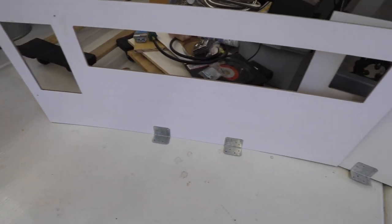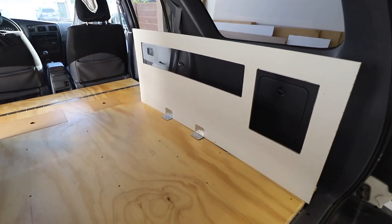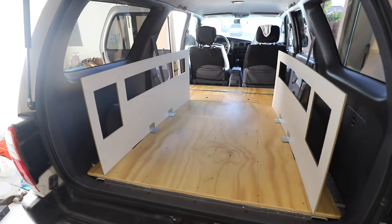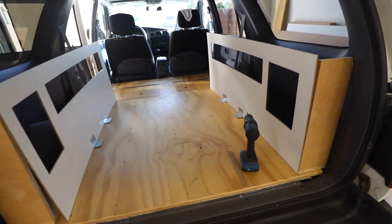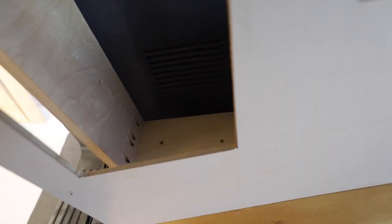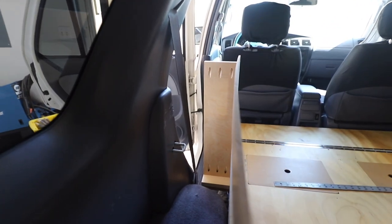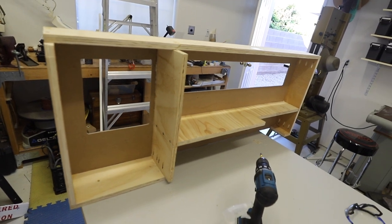I cut panels two feet high by four feet wide, then made cutouts to insert some shelving. I put Simpson Strong-Tie brackets so I could position them close to the wheel wells. They're just fitted loosely here — not attached yet, no shelves built in, just checking how they look. I've added wood to the ends and will fasten those before building shelving inside. I used a Kreg jig with pocket hole screws to keep the design lightweight — quarter-inch fronts with three-quarter inch sides from leftover subfloor material.